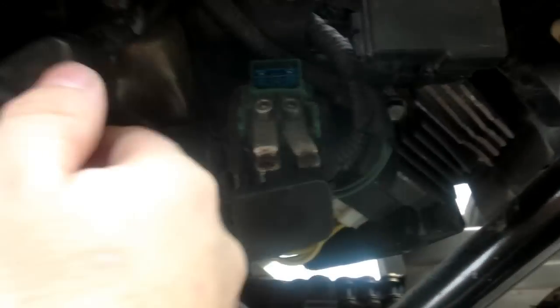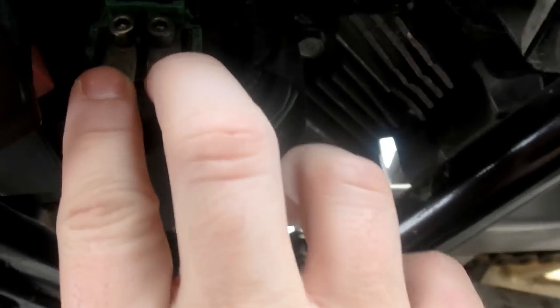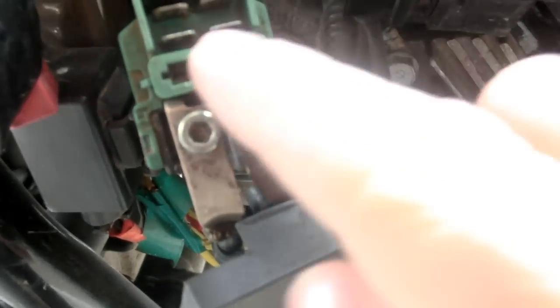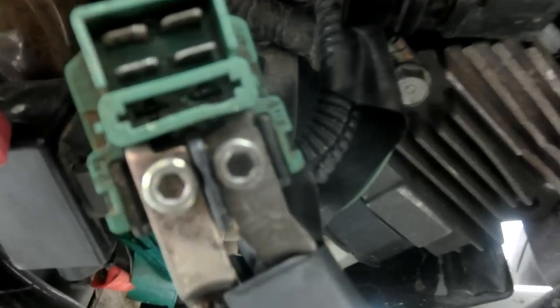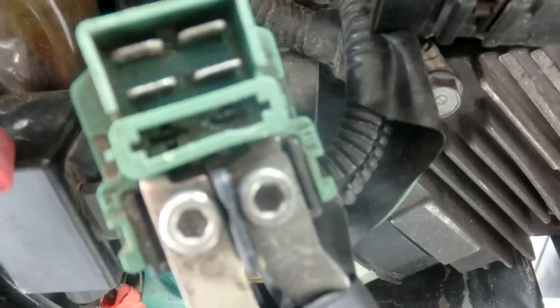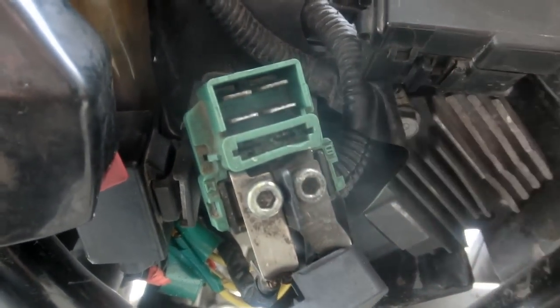Here is the offending part. In order to take this apart — by the way, when you are taking these off, don't let these two wires touch each other, otherwise it's going to start the bike and cause all sorts of mayhem. Let me pull it out. As you can see, I replaced the 10 amp fuse with a 15 amp fuse. I know that's not the best thing to do, but I didn't have a choice when I was on the road. It might look okay, but when you pull this out, you'll see that it's all melted inside there. It doesn't make good contact — the contacts inside are knackered.